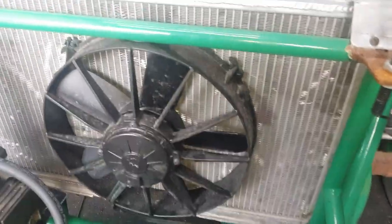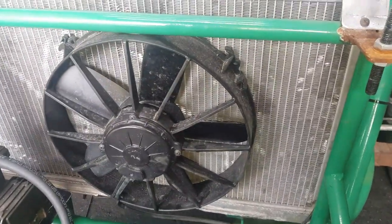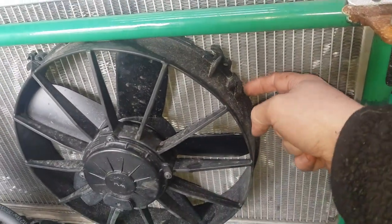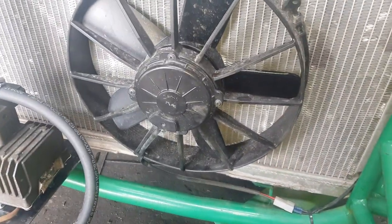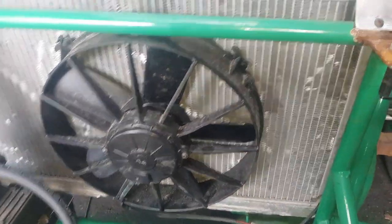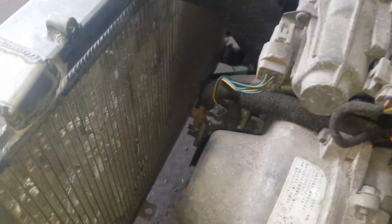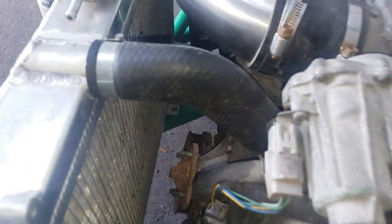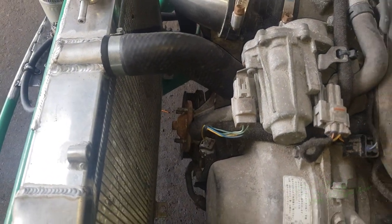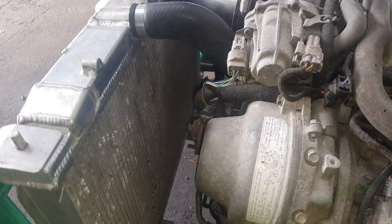The next thing is this radiator. I really don't like the way it's been done - you should never just bolt a fan to a radiator with no gap. There are radiator mounts for a reason. With this build, it's always best to mount the radiator on this side with air going through, but on the bottom we've only got two inches of room, which isn't enough for a fan. So I'm going to have to make my own shroud.